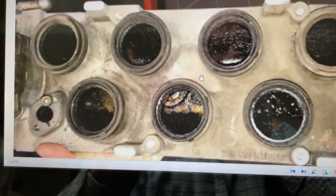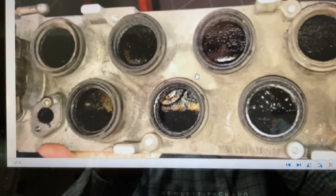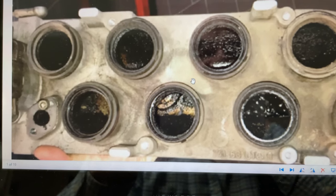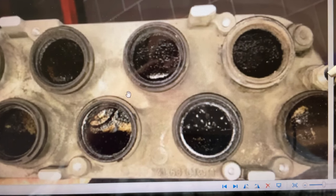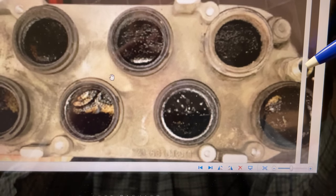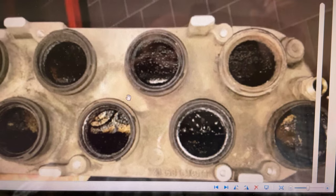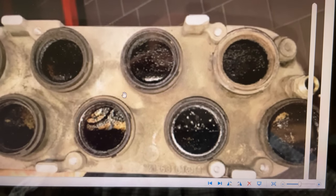The owner sold it to someone in Germany — it's a US federal-spec 560SL, probably a California or Arizona car in otherwise good shape. You can see the damage they had; they had the same problem: rough idle or high idle. They also had the issue with the loose brake booster connector. It would be interesting if other 560 or 420 SEL/SEC owners would check their brake booster connection and leave a message. The check valve in that connection can go bad, and of course the booster itself can go bad too.